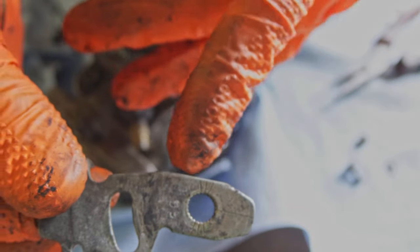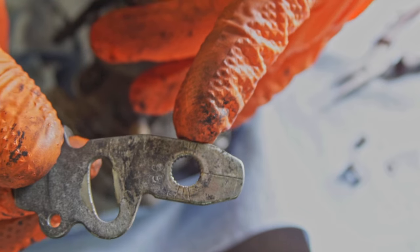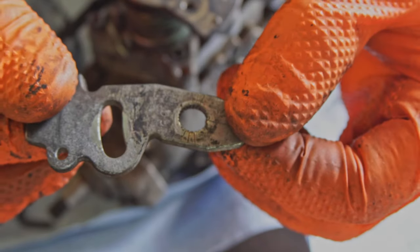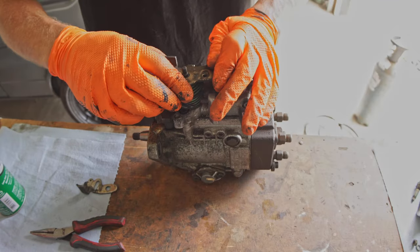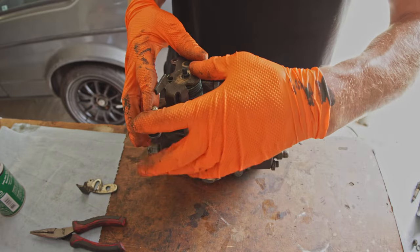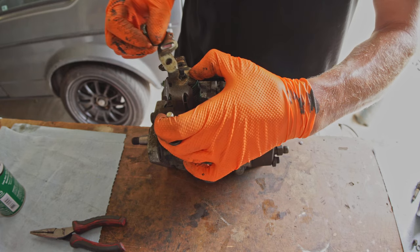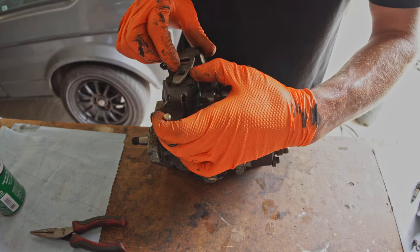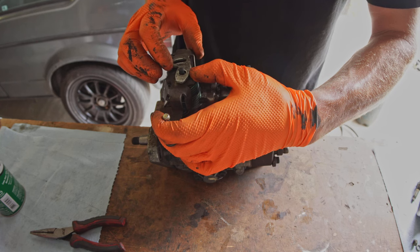So these notches, I think the straight one in the middle would be your neutral. Then there's an advanced throttle and a reduced throttle. So I'm gonna shoot for the advanced throttle, which means I'm going to index this a little aggressively. Gonna spin this 180 and continue pressing down so it doesn't pop off of its seat. Put this the correct way. And I want to pull this back a little.